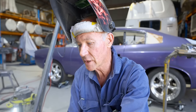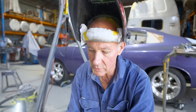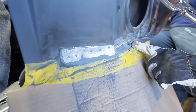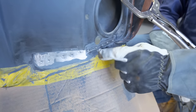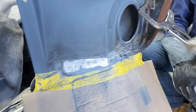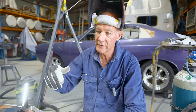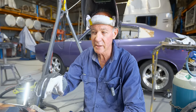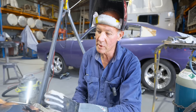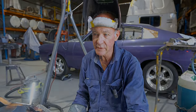Now I've just got a little bit around the edge of these skirts to go, and then around the end of the rails, but the welding has gone absolutely a treat. Very, very well and truly penetrated, right through, right into the back of that skirt area. It's super strong, as I said, and that's one thing you don't want to come off the car, because that ties the whole front of your car together. So it's very crucial that it is right. But done, almost. A few more welds to go on the end of this skirt, then I'll duck in under those rails and finish it off.